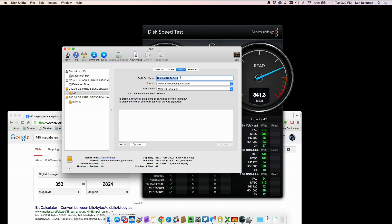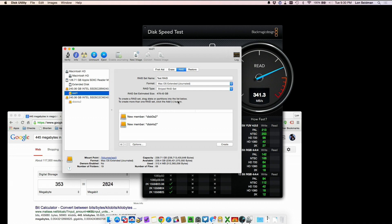In order to use this as a RAID device you're going to have to use the operating system. In this case we're in OS X's Disk Utility, so we're going to call this Test RAID. This is software-based, but on most modern computers that's not going to be a big issue. We're going to set it to a striped RAID set, which gives us maximum performance. It's also going to give us the least amount of data security — if we lose a drive, we lose the array. You need to be very careful in this mode; make sure you've got good backups and you're not relying on this for anything mission-critical. It's good for short-term capturing where you really need maximum performance but have a plan for getting data backed up.